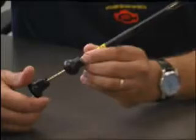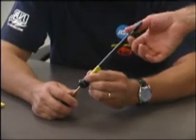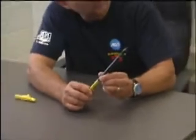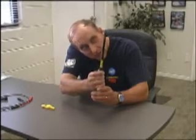So with one-handed operation, you have captured the wire you want to take a voltage reading on. It's easy to connect to free-standing wires, but it's also designed so you can get into tightly packed wires as well. Obviously if you've got a taped loom, you're going to have to separate the wires a little bit. A good example would be an oxygen sensor, which is located in a nasty hostile environment with a hot exhaust pipe nearby. This long probe allows you to reach up there, go in between the O2 sensor wires, loop the one you want, allow it to clamp the wire, and take your reading.